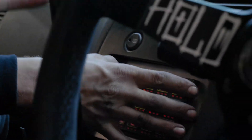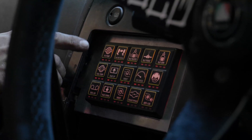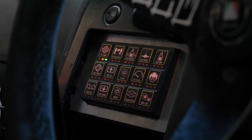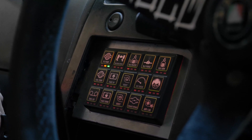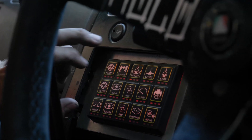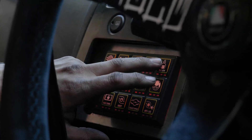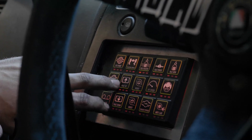With the 3D printed surround it's very clean in the car, very pretty, looks incredible. This is the CAN keypad coupled with the Nexus ECU up under the dash. We've got a few different functions on here: power steering pump in the top left — press that and you can hear the electric power steering pump wind up. Traction control — not set up yet. Nitrous heater — we can turn on the bottle heater in the back. Nitrous purge, nitrous arm — not on yet. Fuel pumps are on all the time.